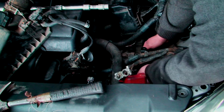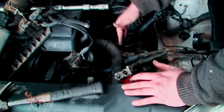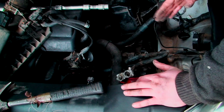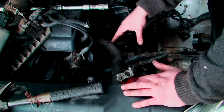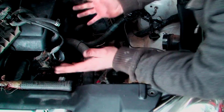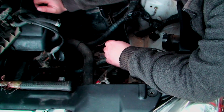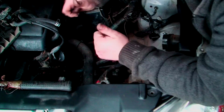Now, what I'm going to do is tighten all these bolts up. Again, I'm going to do the gearbox mount bolts first, and then I'm going to do the big main bolt. Then I release the jack, because the jack's still taking all the pressure at the minute, which is what you want. So tighten all them bolts on. Now, all done. Engine is now supporting itself. Obviously, we've still got to put the other mounting brackets on, but the engine is basically holding itself in place. Sorted.